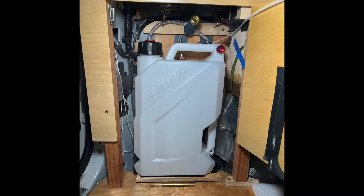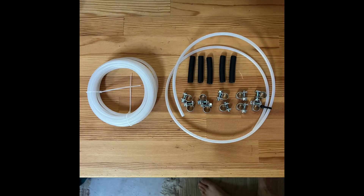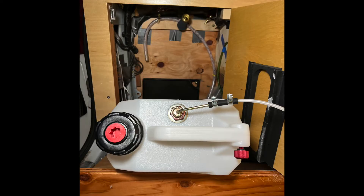Finally, I bought a proper fuel tank from Risk Racing. I could crank down the cap as tight as I wanted and it was really nice thick plastic. I also invested in the proper Webasto gas line and discovered that the cheap green fuel line actually let odor come through it — it stank. I debated whether to put the fuel line into the bottom or top of the tank and ended up doing it on the top to reduce the chance of leakage.